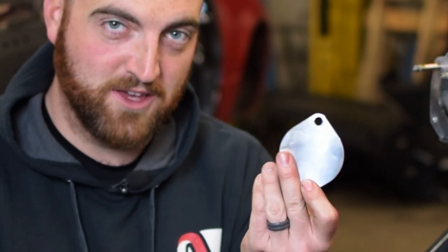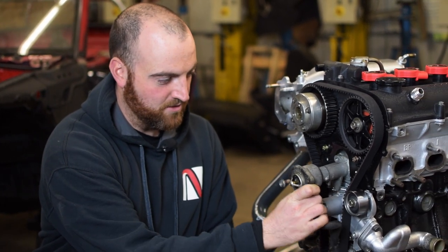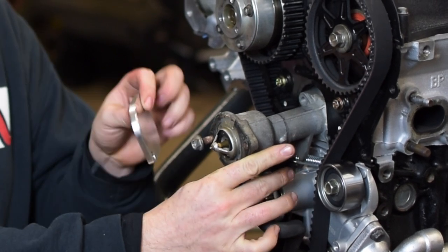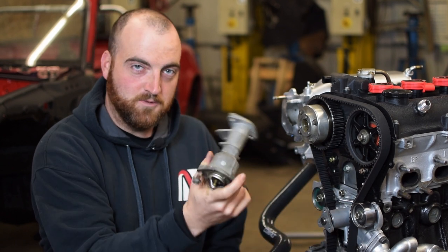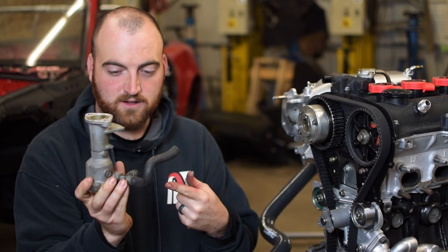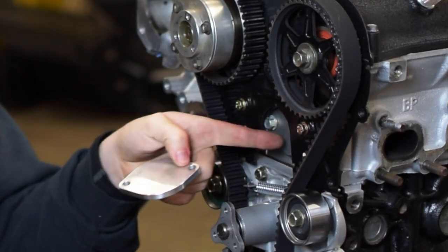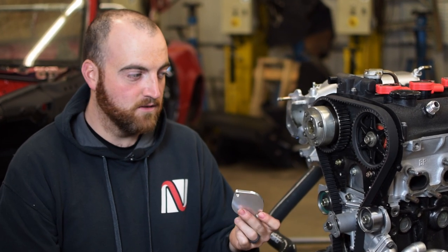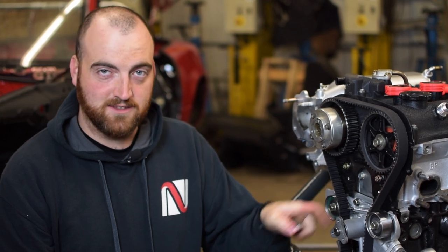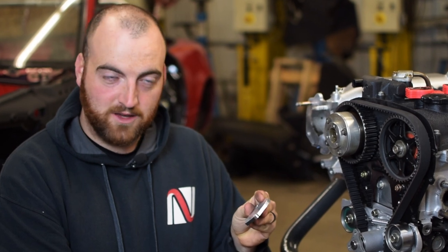The one part we are not going to install is the blank-off plate that goes on the front of your thermostat neck. Typically it sits on the front of your block — you'd take the thermostat out and just block this off, which removes the front water access to the radiator. Since we don't need the ports on the front of the motor, I whipped up a smaller block that blanks off in here instead. If you're doing it in the car, you don't have to take your timing belt off or do any of the stuff behind there. You just bolt this right up, put a gasket in between — the gasket and all hardware are supplied — and your coolant is then rerouted.